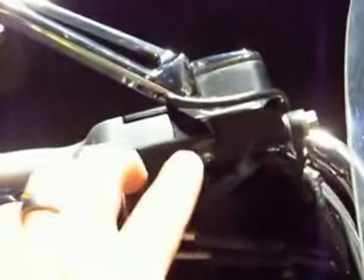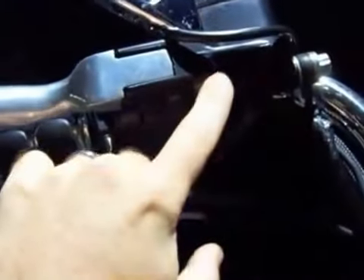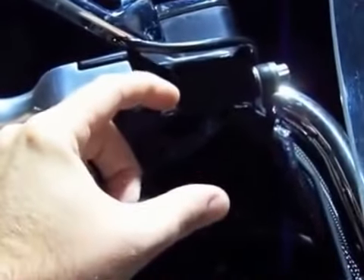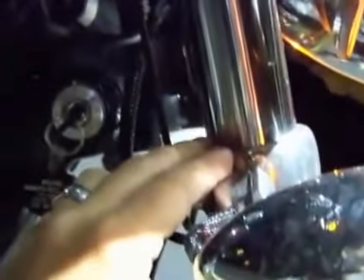You just simply run it down the handlebars and tie it into the existing turn signal wires, which are usually located down around the headlight area. On stock Harley-Davidsons that have the turn signals mounted on the lower stock mirror stem, they'll be right in this area. Rivco has a kit you can get free of charge if you let them know you want it, that'll allow you to mount your stock turn signals right back where they were. Or you can buy a relocation kit from Harley-Davidson, or Rivco Products also makes a relocation kit.